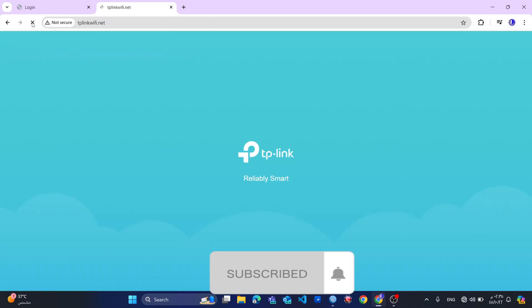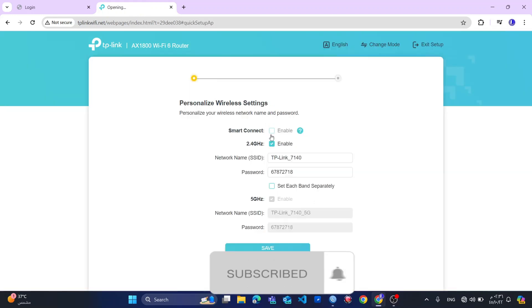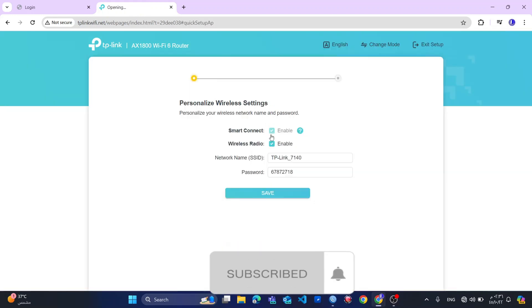It's up and running. I will put my password and log in to my router. Here there is Smart Connect. When you enable Smart Connect, it means you have told the router to use two access points — 5G and 2.4G. It will automatically select which one is best for you when connecting. When you have two devices, one with 2.4G capability and one with 5G, the router will automatically select the best band for your device.